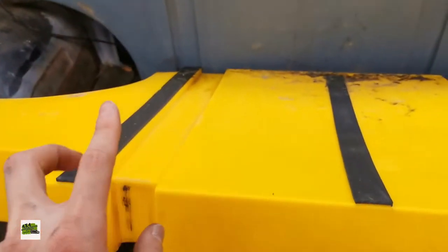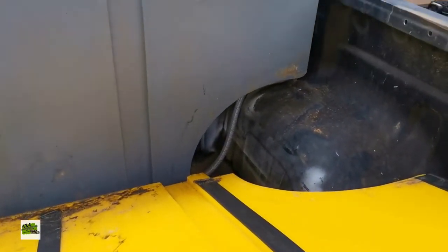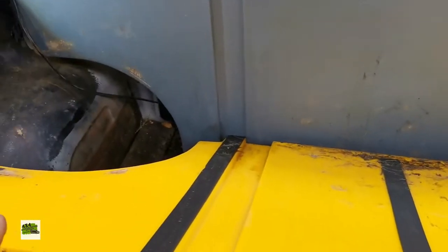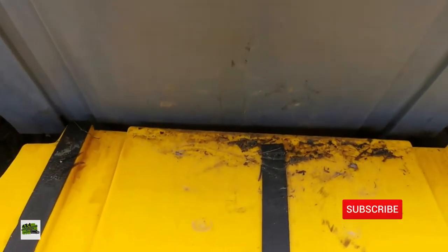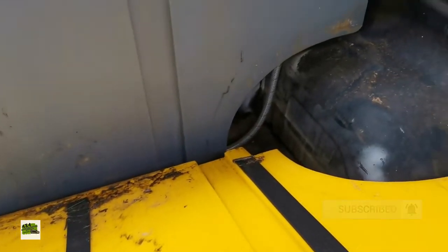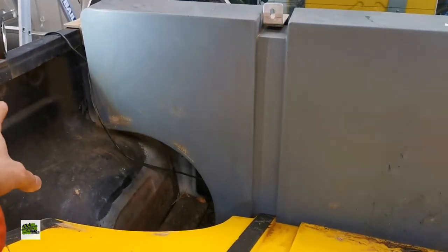Number two advantage of having a diesel tank like this — a wheel arch type diesel tank — is that it sits very well in the ute body. It's designed for use in a ute body and gives you a really good use of space, because you can't really put many things between the wheel arches anyway. Also, they both weigh around 40 kilograms, adding up to around 80 kilograms total, positioned at the strongest spot of the chassis — right over the rear axle. Having the heaviest weight on the rear axle is best for weight distribution.